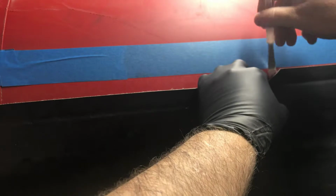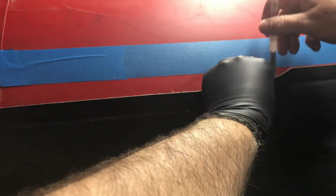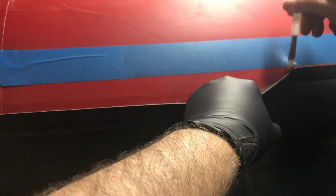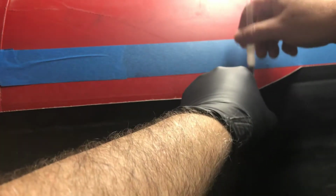and just how many sections I'm going to have to re-glue, because they say the working time on a can of glue is like an hour, I think, or something. It says before the glue starts losing its integrity and its bonding. So it's sort of weird. I found some directions on one of those inflatable boat sites online that come up when you Google it, and it said three thin coats, waiting 15 minutes between coats, and then you assemble it.